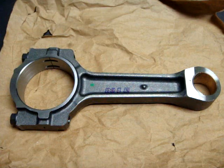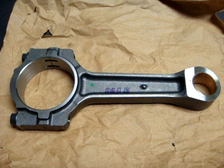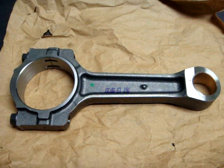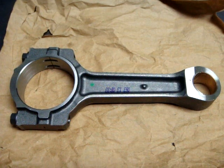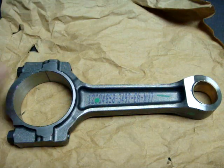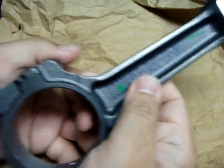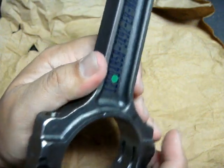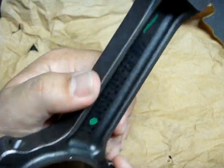That piece is then brought into forging temperature and then taken out of the furnace, placed into a fully enclosed die, and then struck once to cause densification of the material within the workpiece and also to bring the workpiece into its more final shape. After the striking step, the connecting rod is taken out of the striking die, and the excess material flash that is actually generated from that is machined off.